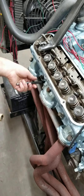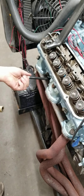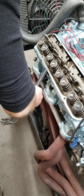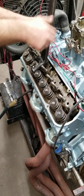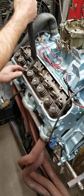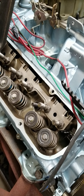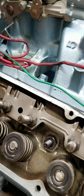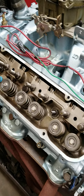This is a good time to also test to make sure that the intake and exhaust valves are sealed up. We vacuum test all of ours so we know they're sealed when we put the engine together. But if you're doing this at home and didn't do the valve job and don't have a way to vacuum test it, this is a good way to find out. If you have an exhaust valve leaking, you're going to hear it out of the exhaust pipe. If you've got an intake valve leaking, you're going to hear it through the carburetor — you'll hear a hissing sound. That little bit of hiss you're hearing right now — that's normal, that's the rings. There are gaps on both ends of the ring, so you're going to get a little bit of air escape by the ring, and that's just the way it's supposed to be.